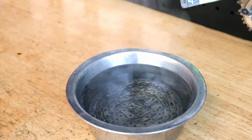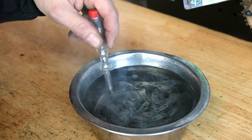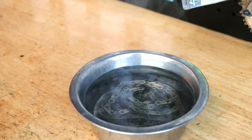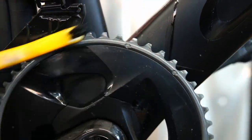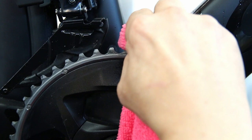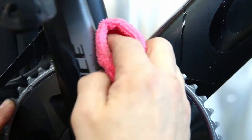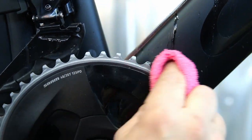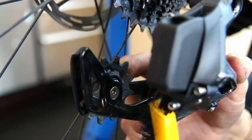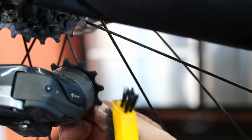As you can see here, the first thing we do is to put the chain in boiling water, because that melts the old residue of wax that's on the chain. You've got to remember this chain's got no oil on it, so it's not going to need degreasers, but you have to remove that wax in some way, and the way I do that is with boiling water. So once that's sitting in there simmering away, I leave that while I'm doing these other jobs — I just brush off and clean off the residue of wax that is left on the derailleurs.